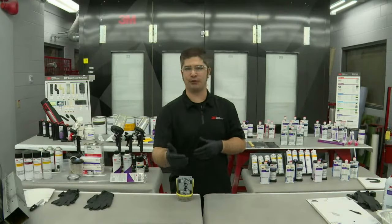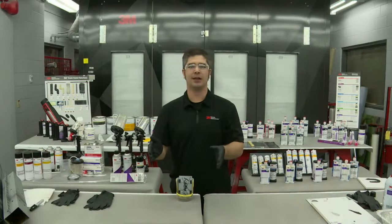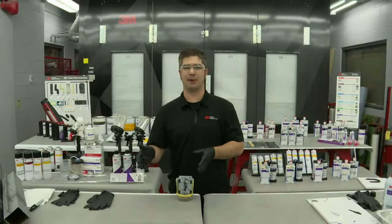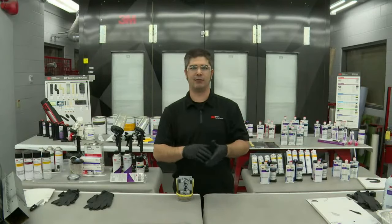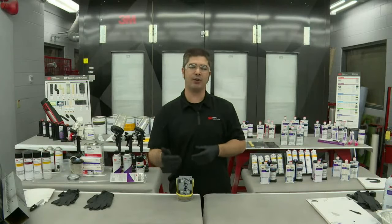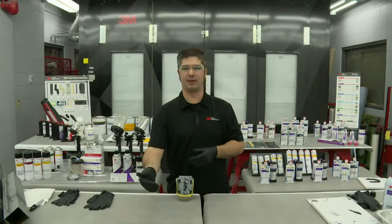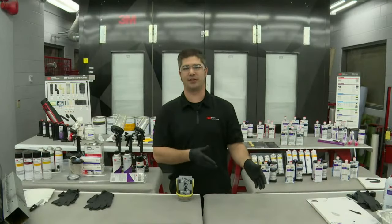But in the case of Toyota, if you're working on Toyota vehicles and that bulletin is out there and exists, and it does, and you don't have epoxy primer on your mixing bank, my first question is, how are you repairing any Toyota vehicles? And that's Toyota, Lexus, and Scion, right? If you're on a Toyota repair program and you are a certified repair facility and you don't have epoxy primer, how are you repairing these vehicles properly? Because they tell you right there, and this bulletin has been around for more than 15 years.